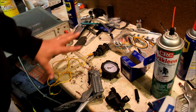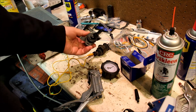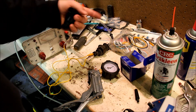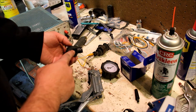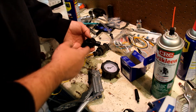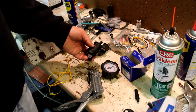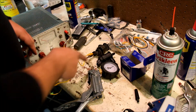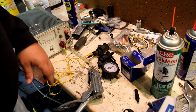As an explanation of what's actually going on here, in case you don't know: think of this as a switch, that's all this is — like a light switch in your house that you'd flip on and off. The power for the flipping on this switch is 12 volts, probably your car battery. So when the computer sends a 12 volt signal that says we need more recirculation, this valve opens. It's just a valve that opens on a 12 volt trigger. If the valve doesn't open, then it's faulty — pretty easy to see.